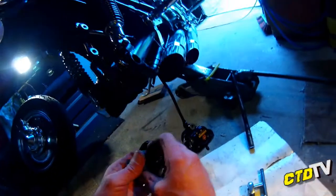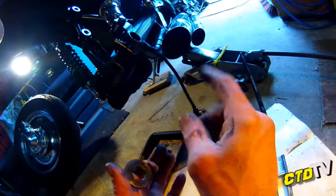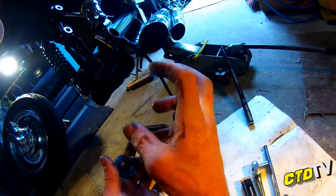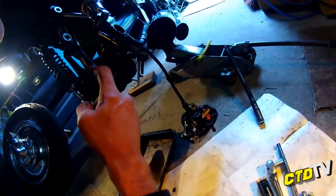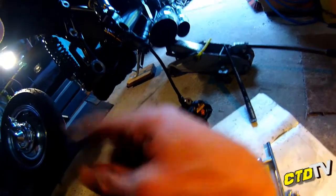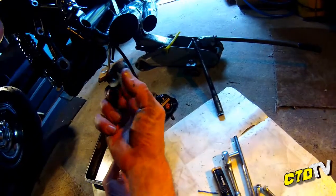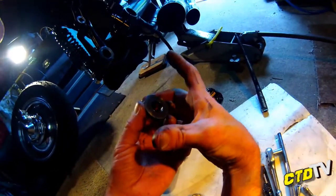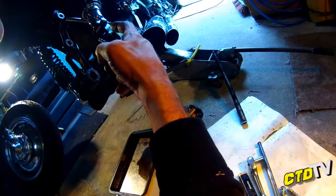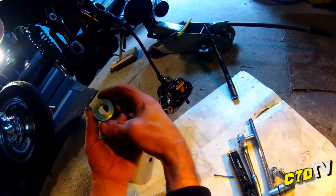One thing you've got to watch with spacers is that they can't press up too much and they can't press up too little. You want them to press on the inner face of the bearings so everything can roll. That's where you want to press up. So you've got to watch your spacer's width, as far as whether they're going to press against the outer ring of the bearing or the inner ring, which is against the axle.